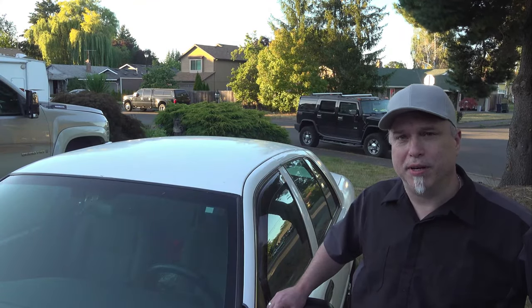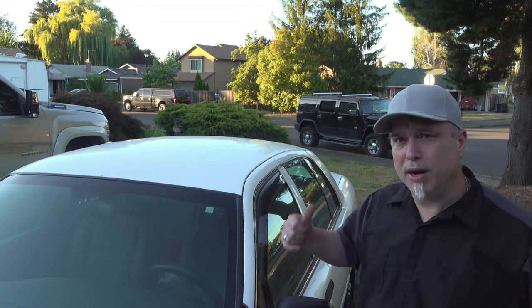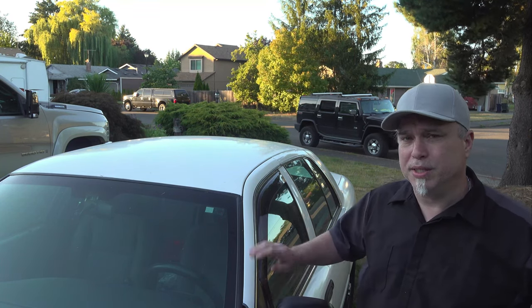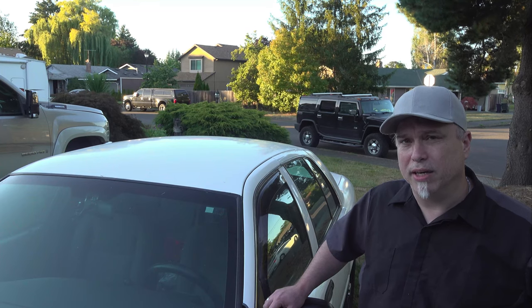That concludes the paint portion of this video. It was kind of a drag there towards the end. I had some paint issues, but if you encounter a problem that's kind of big, like I did on that rear quarter panel back there, just stop. Don't put any more paint on. Cut your losses. Stop painting that panel, come back and fix it later.